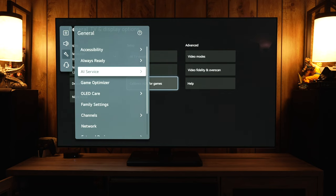Go to Color on the TV menu and White Balance — it'll be at zero by default in game mode, so change that to warm 50, which is as close as it gets to D65 without a calibration. Under Clarity, pretty much everything is grayed out — apply to all inputs. You can also go to General > External Devices to enable 4:4:4 mode if you want, though I experienced more issues with that enabled on this firmware and panel. The Deep Color option is here as well, and should be automatically detected when your device is on.